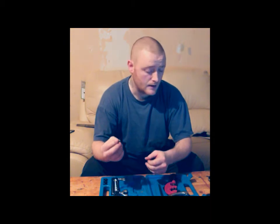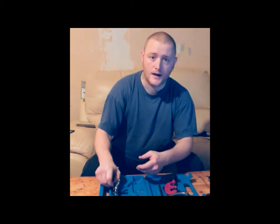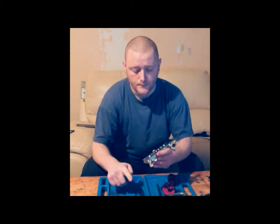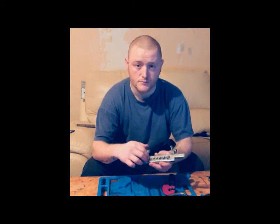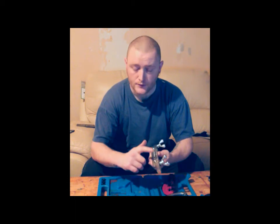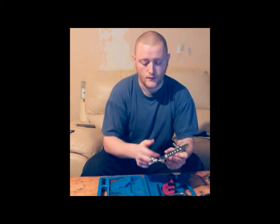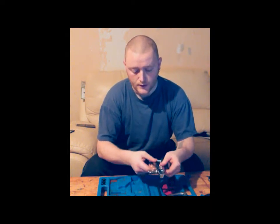This is the one that we're going to be needing: 3/16 for standard brake pipe. It has two sides to it — a flat side and a side that's got some chamfers on it. This is the side where your flare is sitting. You can identify it as it's got all the numbers for the size of pipes. You've got an end that opens out, and this end is just on a small pivot on this side and just clamps up.